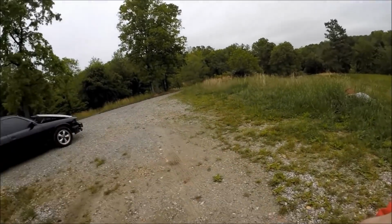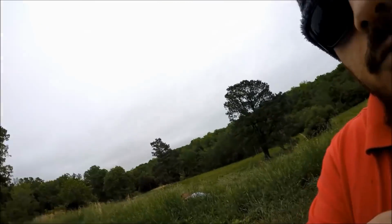So if you guys didn't know, what I did last time was I cut the mufflers off the black Crown Victoria. I only cut off the back mufflers, and it sounds fire, homie. But now today we're gonna change it up a little bit. We're not just gonna cut the mufflers, we're gonna cut the rear cats. That's right, you probably didn't know your Crown Victoria has a set of four cats. So what we're gonna do is we're gonna cut the last two rear cats.